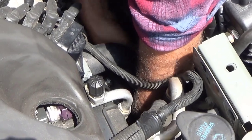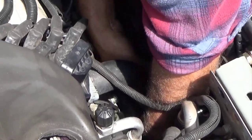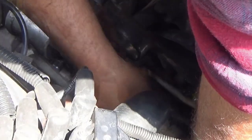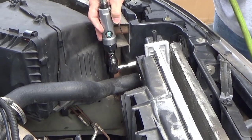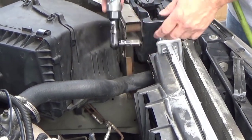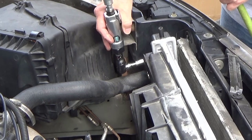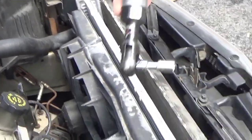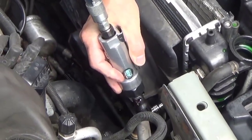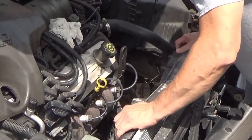At the very bottom and hard to see there's one 10 millimeter bolt you've got to undo — that's got the line pinned to the cooling fan shroud. When doing little bolts like this, it's helpful if you get the right length extensions. Not everybody has an inch and a half length extension, but I'll try to find one and put a link down in the description.